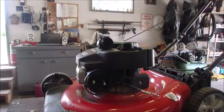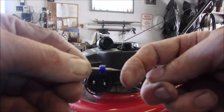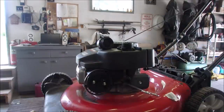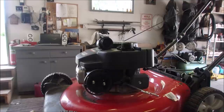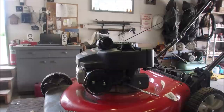And the last time I did this, I used the blue one. This is a micro drill bit. That is not the drill bit. It is there. See that? How small that is? We're just gonna see if this is the one. Okay, it's a little bit sticky, so let's go get the one that's one step smaller to make sure that passes through there real easy. Yes, it does. So I'm going to just drill this out so carefully, right? That's her. Now we clean it out with the spray again. There, repeat, and then rinse.